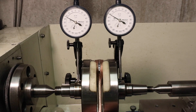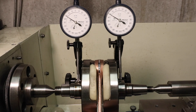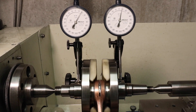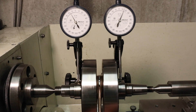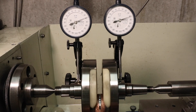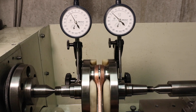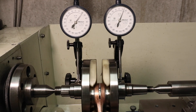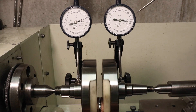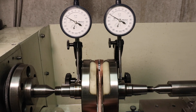Regarding the actual run-out: the clutch side is going from a maximum of about 40 down to just below 30, so it's a little over 70 microns run-out. The flywheel side is going from about 30 to just less than 60, so that's about 90 microns run-out. The spec is 30 microns, so on the flywheel side it's approximately three times the spec, and on the clutch side it's just over twice.